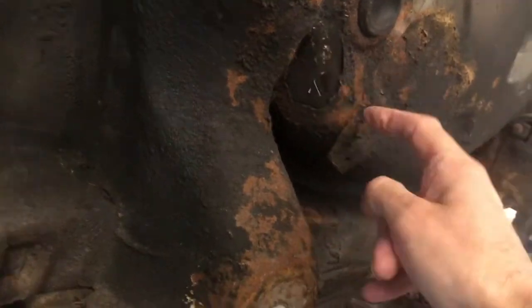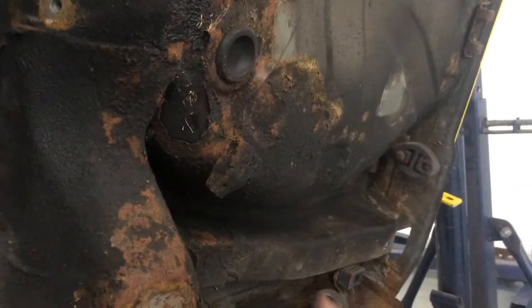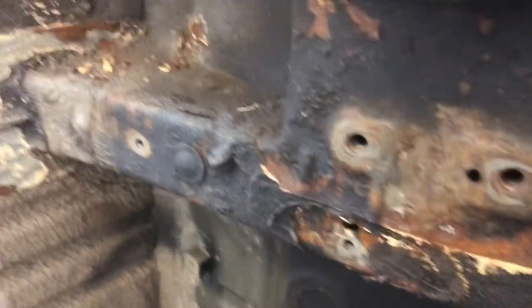Someone has not very well put a patch in here, so this area is going to have to be cut out. This is a spare wheel well and done properly. It looks bad but it's not — it's all surface corrosion. I've seen some terrible ones. The good thing is the underseal on these is just so thick, so it's nothing that a sandblast won't sort out.